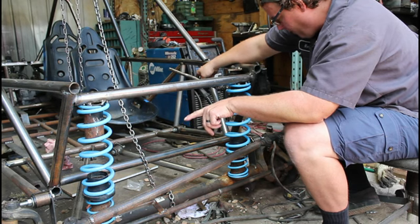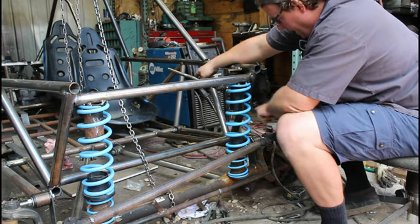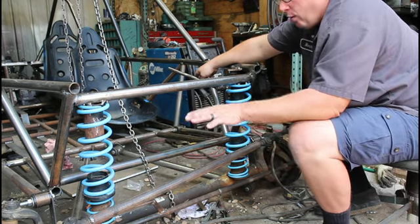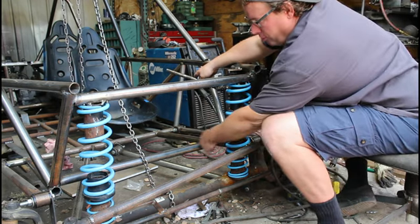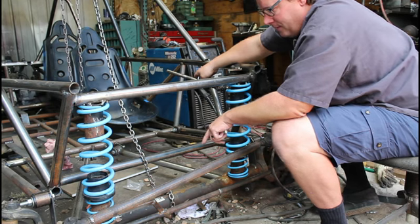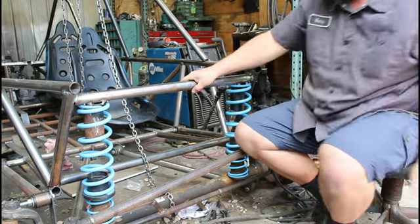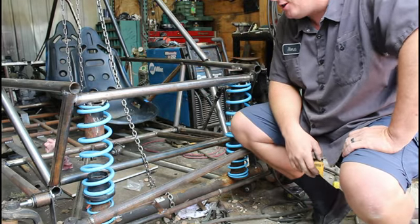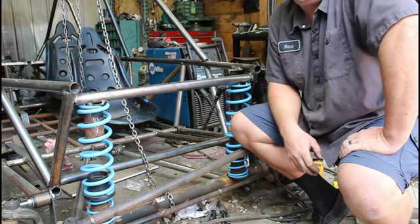Now if I want to fix it, there might be enough play if I just run a panhard bar on the other side of this, that's at the same height as this. It, in theory, would get rid of that, but I don't want to do that because I don't have a lot of room behind here, and I still need to put some Fox IFP smooth body shocks in the center. If I was doing 70 miles per hour down the freeway and I hit a bump, it's probably dangerous, but it's just a buggy. It's just going out in the dirt.